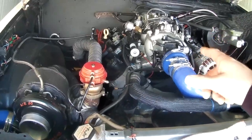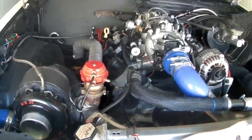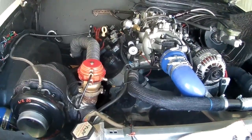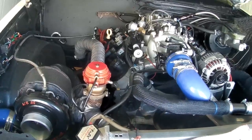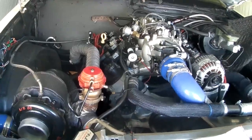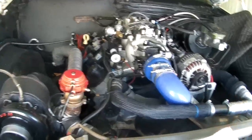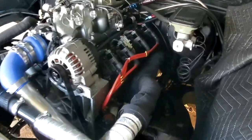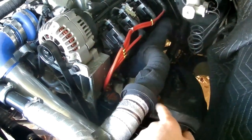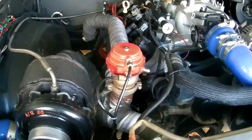Truck throttle body, truck intake. It's got Siemens Deka 80-pound injectors in it. Stock rockers, push rods. And it's got PAC-1218 springs in it. It's basically straight out of the Sloppy Mechanics builds. Flip truck manifolds on it. They are just welded here with V-bands on it. 2 1/4 inch exhaust. And that's an Amazon 44 millimeter wastegate.